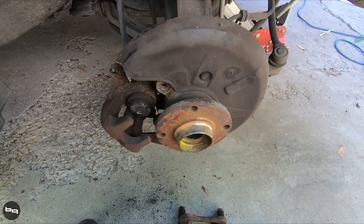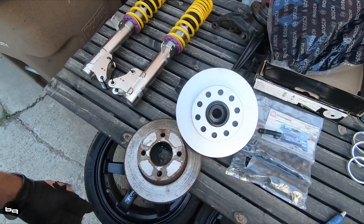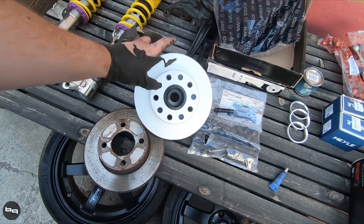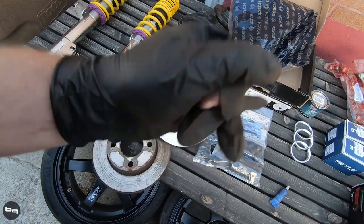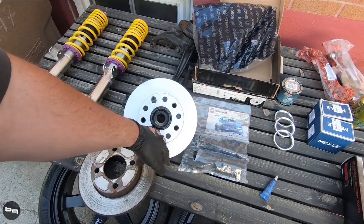In the rear it's really easy. The new hubs I have on the table are 5x112 and they're from the rear of a B5 A4 Quattro. Basically I can slap this setup with the B5 A4 rears with the new disc and rerun my original calipers, original carriers — everything in the rear will line up perfectly, and there's literally nothing I have to change as far as brakes go. It retains your original caliper, original braking, and the original e-brake. Super simple, up and running in no time since it's the exact same dimensions, and these are readily available here in the US.